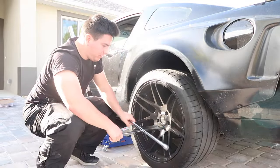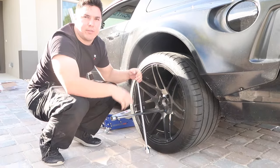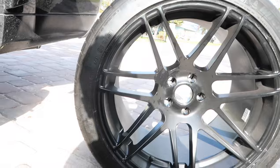First we're going to take the wheel off so we'll have better clearance. All right, we got the wheel off. Another thing — if you used an angle grinder instead of a jigsaw like we did, the metal would be sticking out further than the body. What you could do is cut slits in it, fold it against the body, and weld it on, and it'll be pretty clean. But since we used a jigsaw, we're going to have to fill it with the gap filler.